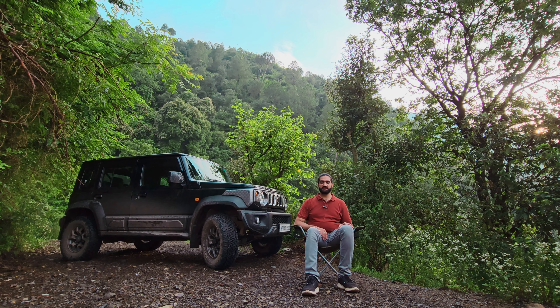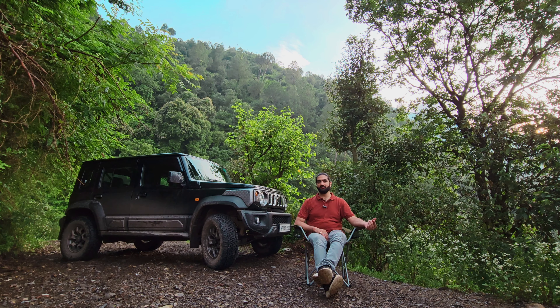Today I will take you on a test where we can find out what problems and situations particularly cause the 235s to create issues. The major issue is that they start to rub the body in extreme articulation scenarios, and there is very little gap available to accommodate snow chains, which are compulsory in icy winter situations. With a 235 section tire on the Jimny, there's very little chance to accommodate a snow chain because the gap between the underbody of the wheel wells and the tire itself is very small.